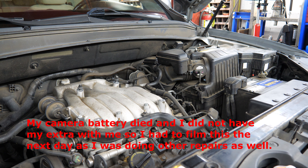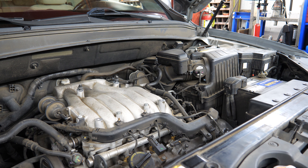The purge valve is on and working like it's supposed to. I checked with my scanner — it's closing and opening, you can hear it clicking. Check engine light is off. I did have it running for a while and even test drove it a little bit — no issues. I didn't end up taking the throttle body off; you can get to it without that if you're comfortable. It saves a bit of extra work, but if you want more access, by all means take it off. This is pretty much a job you can have done within an hour — it's not a huge job.